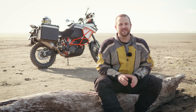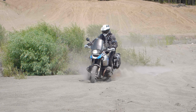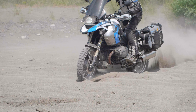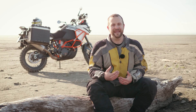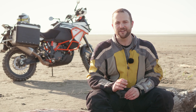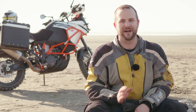The current generation traction control system is pretty invisible most of the time while you're riding, but the number one situation where you absolutely will feel it and it will cause you problems is riding in deep soft sand — sand dune kind of sand where it's really dry and really deep. In that situation, you need rear wheel speed to get the bike moving and get up on top of that loose sand, and the traction control system is going to be constantly slowing that back wheel down and you aren't going to be able to get enough momentum up to even get up the smallest hill. An experienced rider can manage traction really well by moving their weight forward and backward on a motorcycle, managing where the throttle position is, and applying power by using the clutch at the appropriate times. If you give the motorcycle exactly what it wants, your traction control system will never engage. But for a newer rider, somebody who hasn't really fine-tuned their ability to manage traction on the ground, an electronic traction control system is a fantastic way to keep your ride safe and secure.